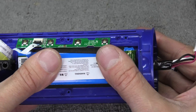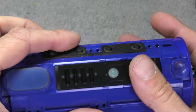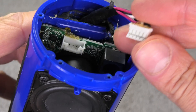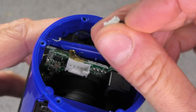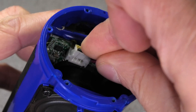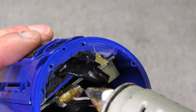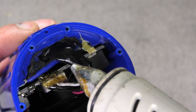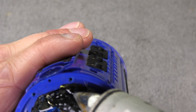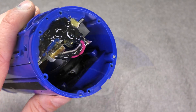Make sure you're not pinching the small ribbon cables — you want those to stay intact, otherwise the buttons won't work. Then close up the cover and put some of the screws back in if you want. Plug in the connector — it's idiot-proof, it only fits in one direction. Don't forget to plug it in. Then I'm using some hot glue to make sure the connector doesn't fall off by accident later when using the speaker. I'm also adding more glue where the wires go through the hole. You can also use silicone or other adhesives, but hot glue works fine for me.